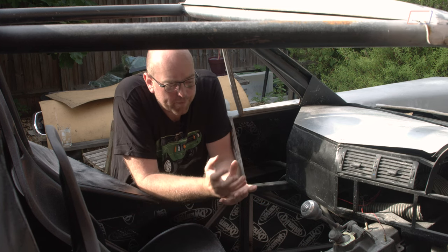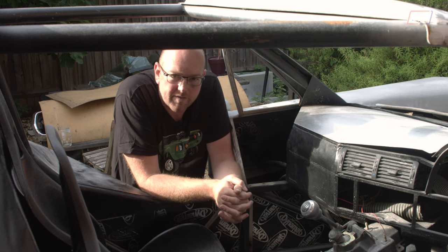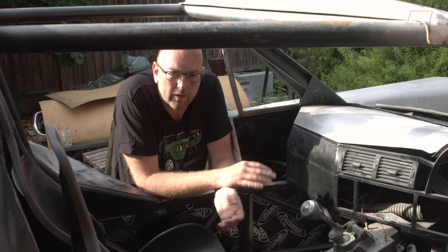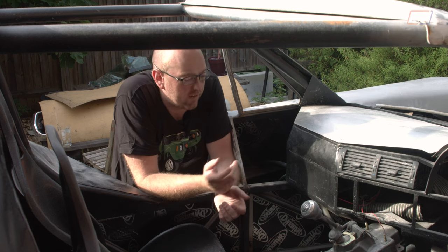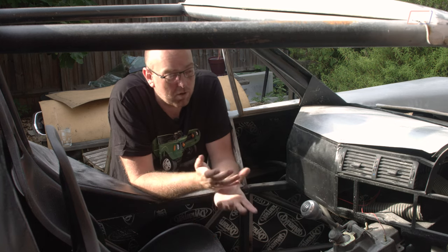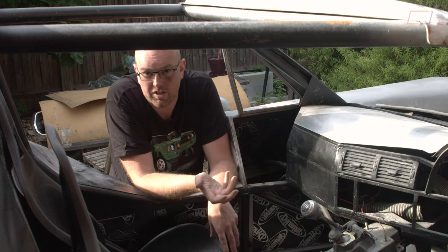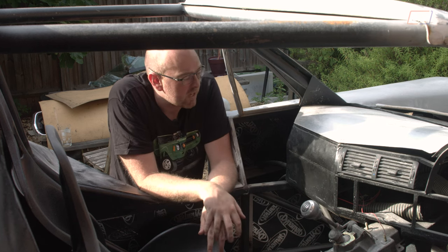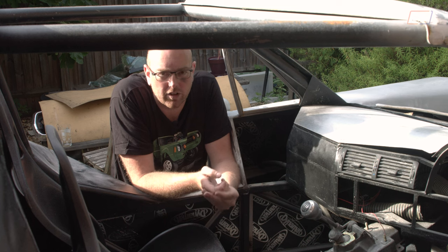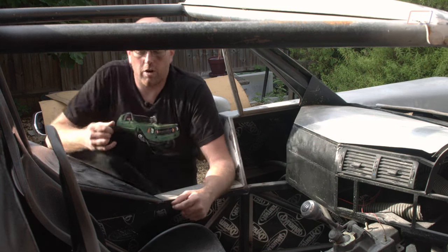In the meantime, what I am going to do is deal with something on the dashboard that's a little bit more in your face — this big steel panel. I'd rather it not ever be in my face, but on the off chance it might end up smacking me around the skull I need to pad it. It's not just because I want to — we have to pad it for the IVA. It requires either three or five millimetres of padding on any solid surface you could come into contact with within the specified zone. Most of the specified zone is in front, where you'd hit it with your hands or knuckles, or if the seatbelt were to fail your head would come forward and smack into it. A little bit of padding isn't going to save you by any stretch, but it's hopefully going to stop it being quite so catastrophic.